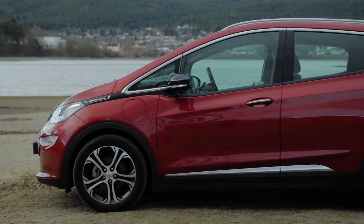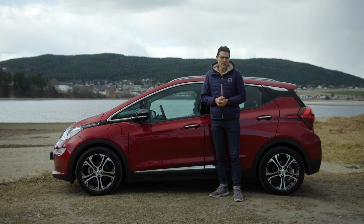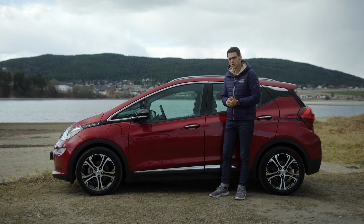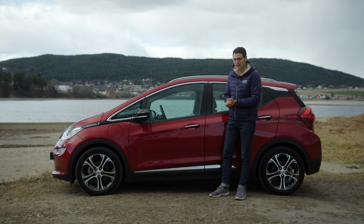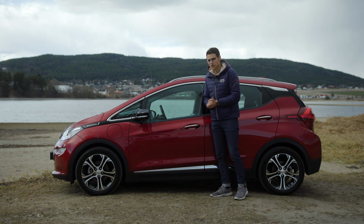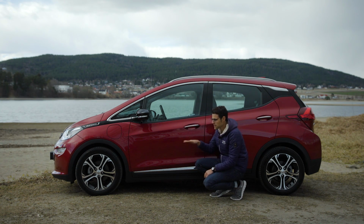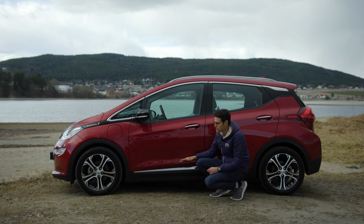What about the weight? It's about 1,600 kilograms. That's about what the Golf has. 300 kilos lighter is the BMW i3 because of the carbon fiber chassis. Here a more conservative layout. And about 430 kilograms of that is the battery, and that is placed right there, in the middle. This also accounts for a rather sporty driving feeling for most pure electric vehicles, because the center of gravity is then also very low, and that is also good for a sporty ride.